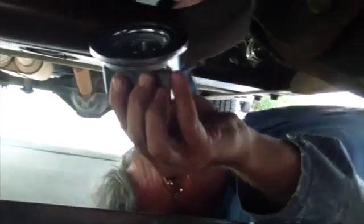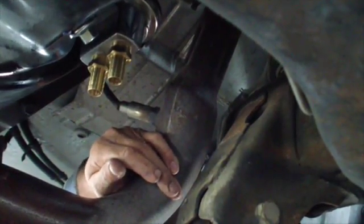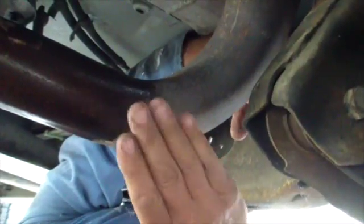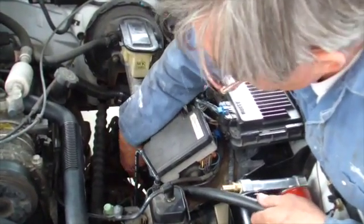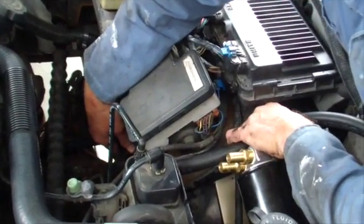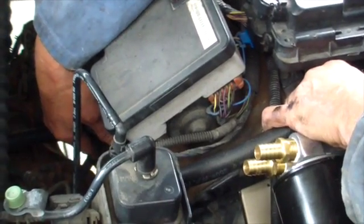It's the spin-on adapter — there it is and it looks good. We have to avoid hoses on the hot exhaust pipe or any sharp edge. It's flat on the bracket. We are allowing a good four-inch bend radius on this hose and we're avoiding the exhaust system. We need to cut this to length and attach everything. It's better to make it a little longer than shorter — you don't want it too short, you don't want to stretch your hose.